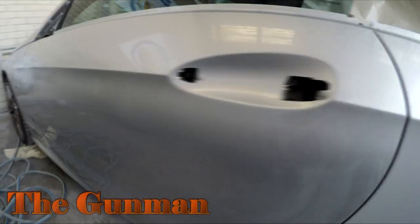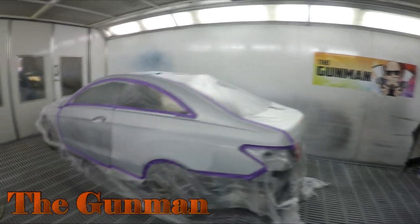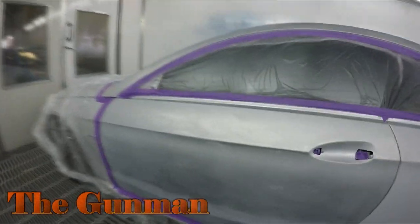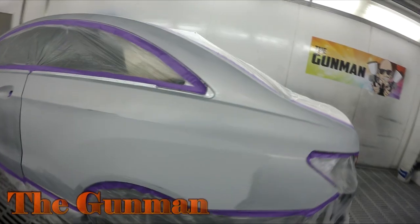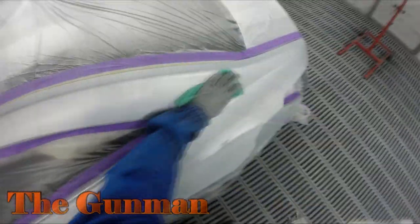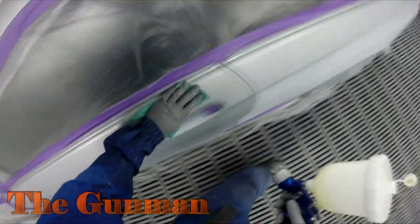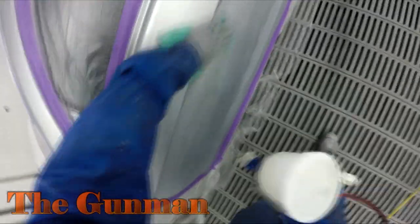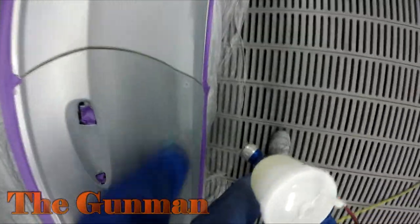This is a quick look at the job before I even started prepping it. As you can see, there are some issues with really average paint underneath — either acrylic or some cheap and nasty paint. When it was primed up it just moved and sagged, looks a total mess. On the back section of that quarter panel it was just peeling at the edge — the prep work was basically non-existent, just painted over shiny paint, which is a big no-no. My sandpaper was just clogging up.